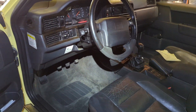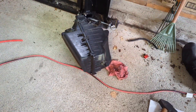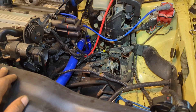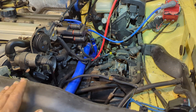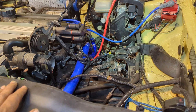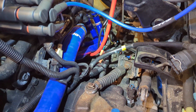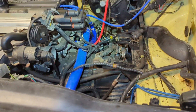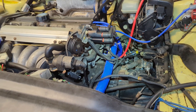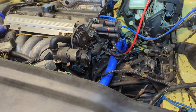Then we got to put together the stuff in the engine bay. And I found out that we have a fresh air intake, not that box. The fresh air intake has an intake tube for a 2.75 inch intake tube, and we need one for a MAF that's 3 inch. So we're going to have to do something about that and order that intake tube from one place or another, so we can get this car running. We don't want to put nothing on the car and start tuning the car to something that's not going to be the final equipment.